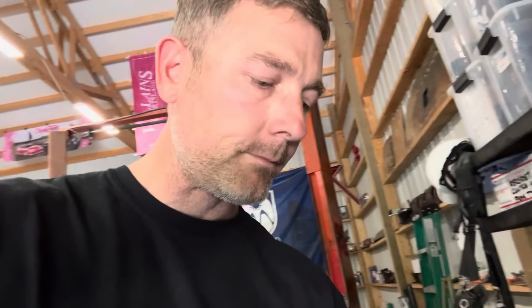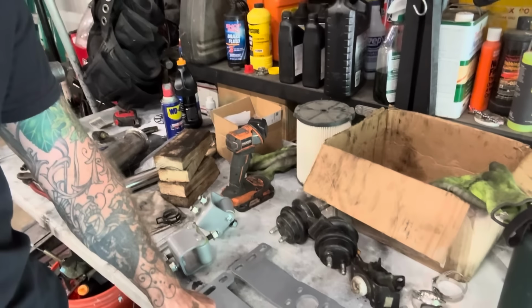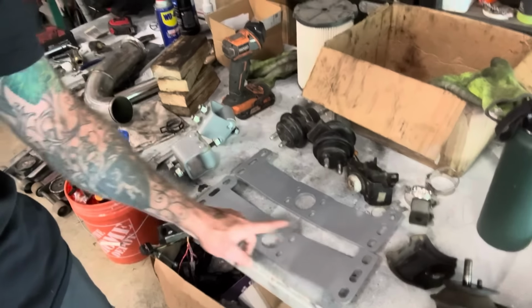So I think I'm going to try to slide these in first, and if they fit and the oil pan still has room above the subframe, it's just going to get new mounts. Also, the R transmission already had a bushing mounted to it, but I don't have a cross member. So Excessive makes 2 different ones, and they're very similar, but the spacing from where they mount to the body is a little bit different. So they just gave me both of them, and they said, bring the one back that I don't need.